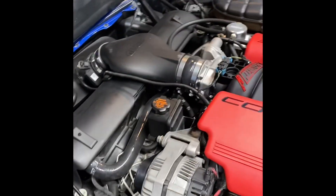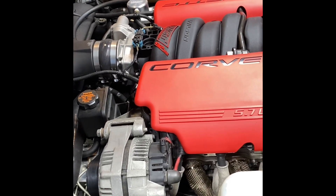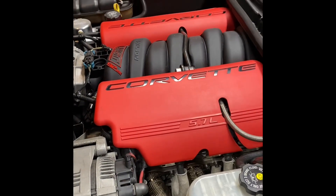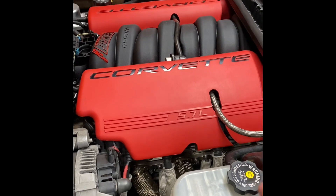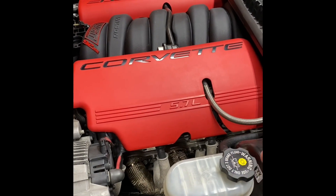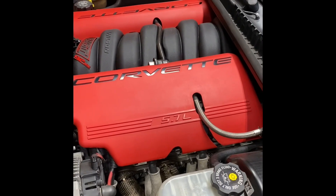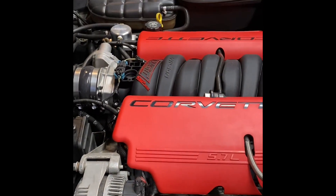I hope you enjoyed it and hopefully some of this helped. For example, with the knock sensors — on the LS2 they need to go on the side of the block. There's no provision for them in the valley cover, and actually it's a better design because you can get to them if you need to change them out. If I helped one person, that's great. Have a great day everybody.